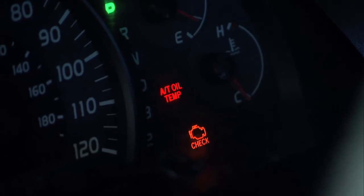If I was faced with a trouble code or a symptom that I needed to address, the first step, of course, is to verify that the complaint exists. And once we've verified that that light is on, then I make a decision as to what tool I'm going to use to access the information in that system to diagnose and repair it. So if it's one of the factory scan tools in our toolbox, naturally that would be our first choice — we'd connect that scan tool, go to that particular system in the vehicle, and access the trouble codes to see what we're dealing with.